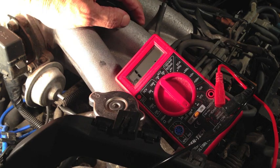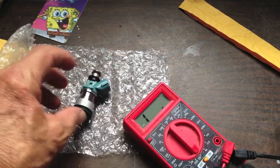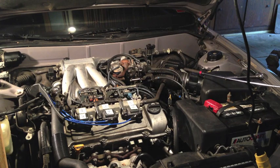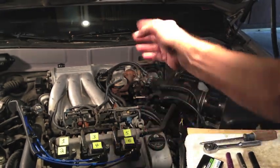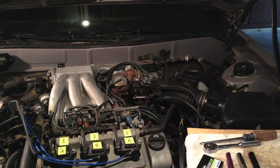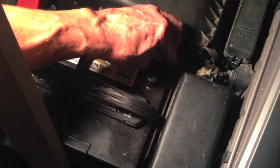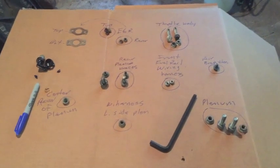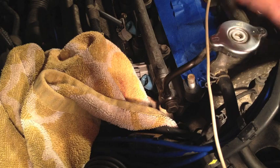Of course it would be one of the cylinders in the back — much more difficult to get to. Here's the new fuel injector. First thing I want to do is test its resistance — 15.4, very close to the resistance on the two we checked on the car, so this should work. Now I have to get it installed, which means taking out the intake plenum, the throttle body, the airbox assembly, and the wiring harness leading to the front fuel rail. Before you get started, I'd suggest taking a lot of pictures — front, back, right, left — of where all the vacuum lines and wiring harnesses go. Makes it a lot easier when you're putting it back together. First I'll disconnect the negative battery cable to de-energize everything. I'm using a piece of cardboard to keep my fasteners organized. It took about an hour to get all that off — if you need step-by-step instructions, look for a link in the description to a video by Speedcar99.